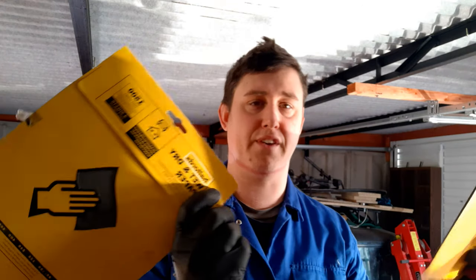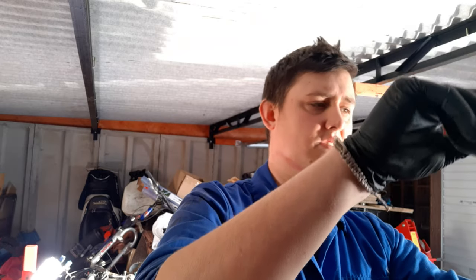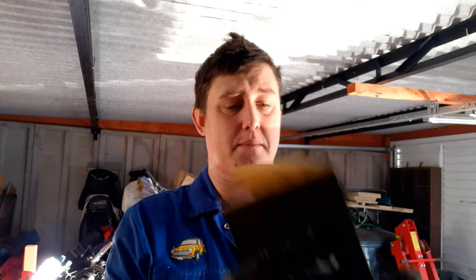I've got a number of sandpapers: I've got 1500, 400 grit, 800, and I've got 2500 grit. The first layer I'm going to do, I'm going to use quite a coarse sandpaper to try and take away a lot of the roughness from the body filler. I found a 320 grit so I'll use that to start. All I'm going to try and do is a light sanding of it, because I don't want to go too much since I'm going to put some more filler on top. This probably isn't the best way to do it, but to try and get the car looking a bit more presentable, this is the way we are going to be doing this. Let's get down here and crack on with this build.